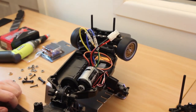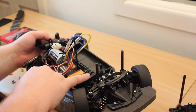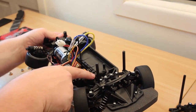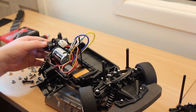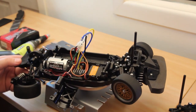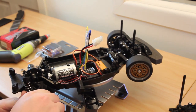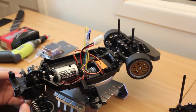That's those bearings done. The only thing you'd have to undo on the front is just move the steering out of the way — just undo these two screws for this, the drag link on the steering, and just pop that out of the way. But otherwise the operation is the same. Same with the hubs as well. Got to take the wheels off and pop the hubs out.